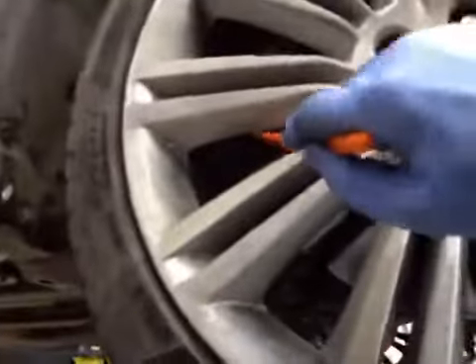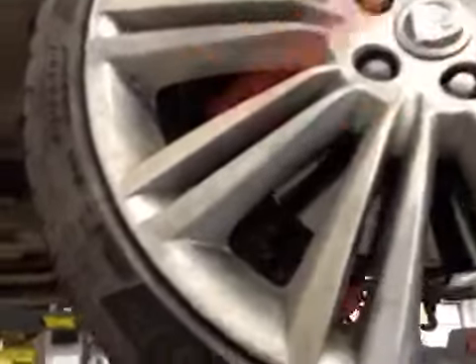Your front disc is in good condition, and your front brake pads on the driver's side are roughly on about 8mm. So the pads are in green, disc in green, and this tyre is in amber on the health check.